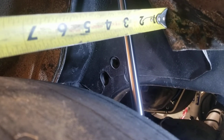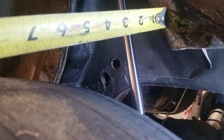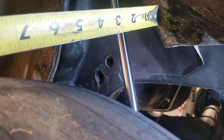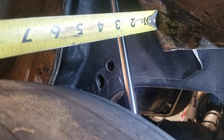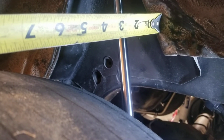Off of that sixty-one and a half overall factory width, that'll put my final overall width of my new 9-inch at about 58 to 58 and a half inches. Very simple to measure — just measure how much backspacing you're wanting on the inside of the tires.